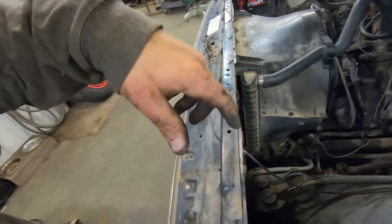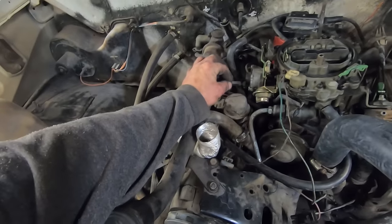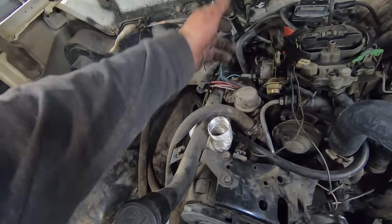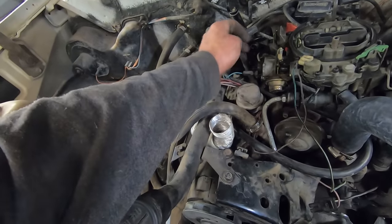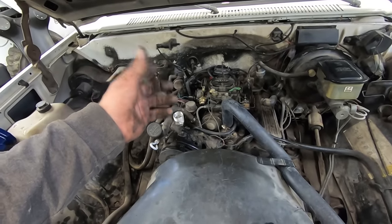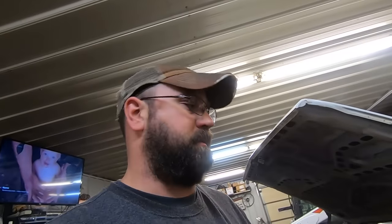And then we chased our tails because I hooked up a line backwards and blew in the tank. It was filling up the charcoal canister. Then I think the choke wire wasn't hooked up because it's some goofy connector, and I don't know if it's broken or they swapped carburetors or what. It's a big spade oddball thing that I don't have, so just snip this off and put on there. Timing was a little bit off, but it was kind of my fault. I'm not going to time it until it runs decent. And yeah, we had a light out. So 4 hours to fix a light bulb. Like Finnegan said, taillight was out, so put a supercharger on it. We took a supercharger off.